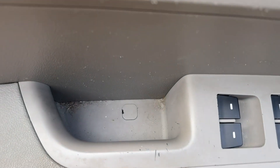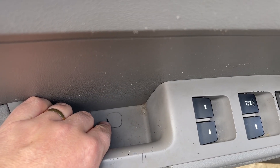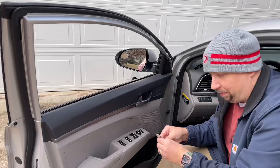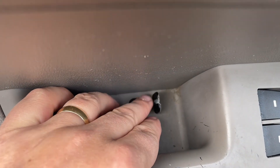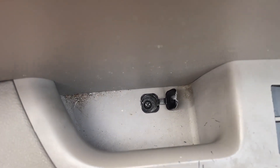What you're going to do is lift this little tab up right here — there's a screw under there. It's only one screw and then the whole door panel will pop off. So first thing we're going to do is dig under it. See, that's popped up now. It could take a minute because there's a little catch here.